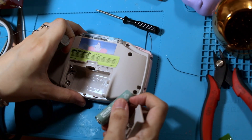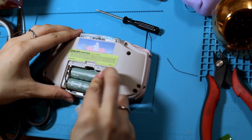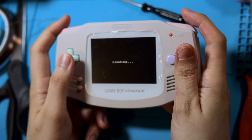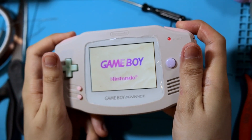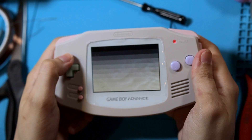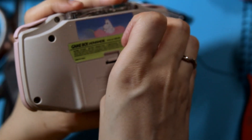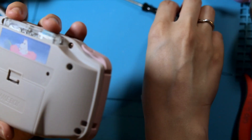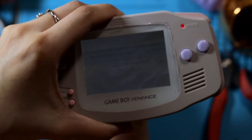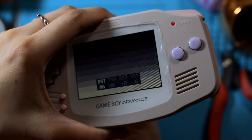Now we're going to pop in some batteries and use the aging ROM — linked in the description below — to adjust the potentiometer. Once you launch the aging ROM, press and hold the L and R buttons and it'll take you to a menu. Select 'test program,' followed by 'LCD checker.' Unless you're very lucky, you should see your screen flickering like mad. The potentiometer is located behind your Game Boy Advance sticker, so hopefully you haven't stuck that on yet — and it's right through that little hole. Use a flat head screwdriver and just twist it until it stops flickering.